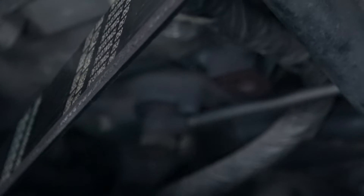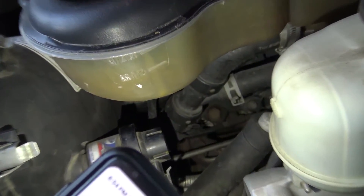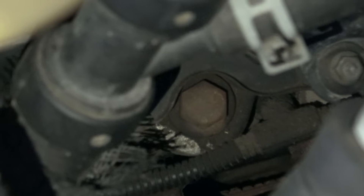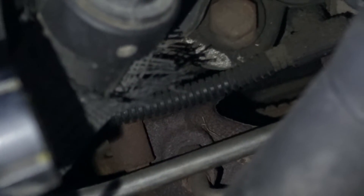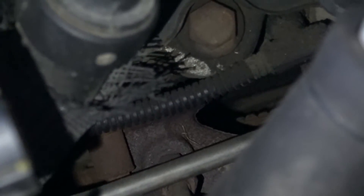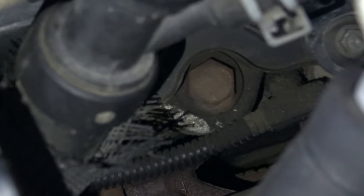Down here is your fuel feed to each head — that banjo bolt looking thing, one for each head — and they just go to your fuel filter housing. If you peek down, you can see I'm still on head bolts. If you have a question on whether or not a truck has been studded, you can look along the bottom edge of the head. If it has bolts, you're on head bolts; if it has a stud and a nut, it looks like it's been studded. That's a way to verify if someone claims their truck has been studded.